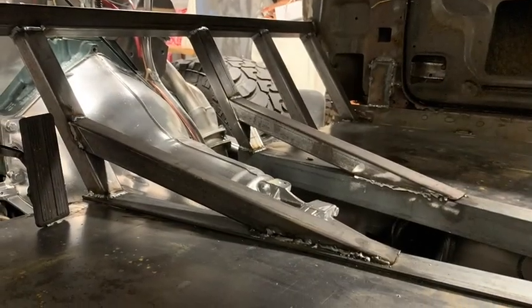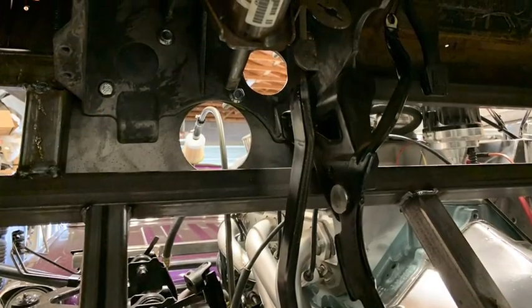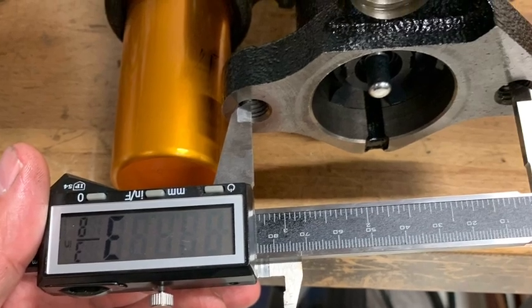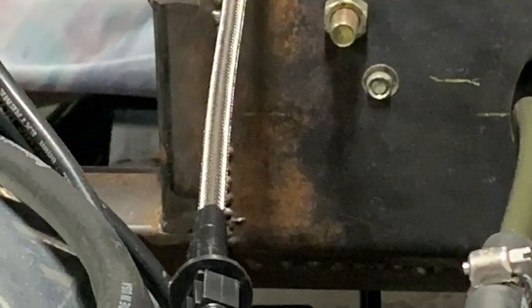But I uploaded the next episode for my monster car build, and you can see how I've reinforced the front frame there where the firewall is, and my shallow tunnel for my transmission. So I put a plate in there and drilled it out the same as the old 2003 Dodge Ram was. And I've got a brake system from a diesel Dodge Ram, a Hydro Boost system, which I'm putting in. So working out the measurements there.